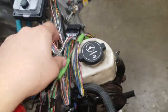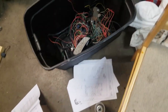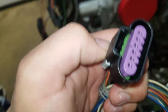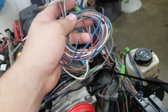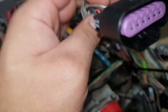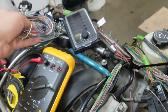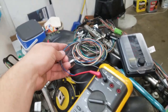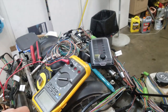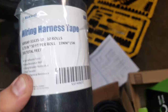I also purchased a throttle cable because in order to plug into here you need a disconnect, which in my case the junkyard engine didn't come with. So I just used scrap wire that I took out, pinned it, and left a pigtail on it — a waterproof connector to go between the body and the engine bay. Relatively easy to install and it's all labeled on the schematic you can find down below.